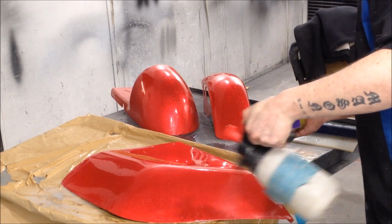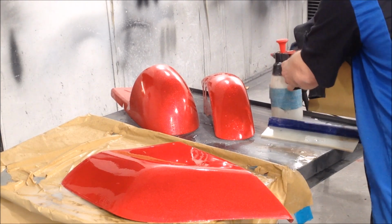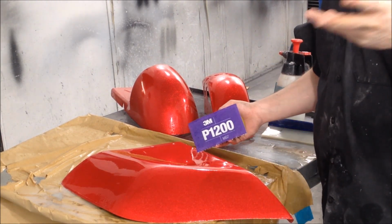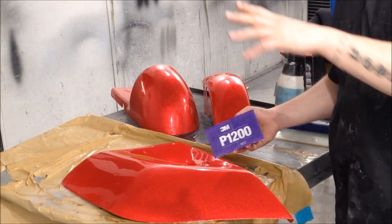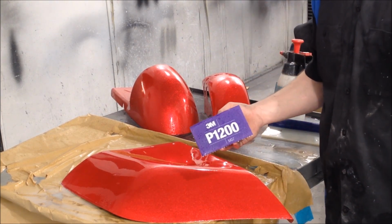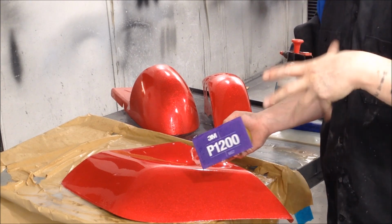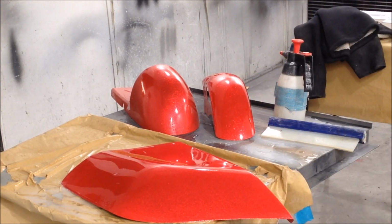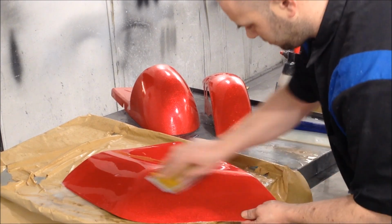And the difference between how you can tell if it's done or not, obviously before on your first cut with the 1000 grit you could see the peel. With this, it's the sheen. Alright, it's like a satin finish on how it's left. It gets more satin-like the more you do. So I'm just obviously checking that it's still doing it.